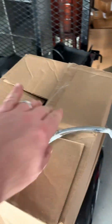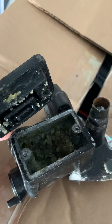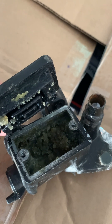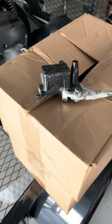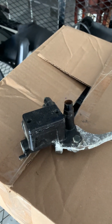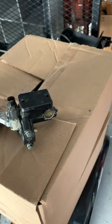The one thing I did find was the brake lever. I took it apart — obviously they weren't working — and found it was all gummed up inside, just gummy and gooey, likely from water or oxygen getting to it. The other brake master cylinder had corroded right through the sight glass. I feel like I could get one back working by cleaning it out, but the other one deteriorated the sight glass plastic, and it's just not very good.